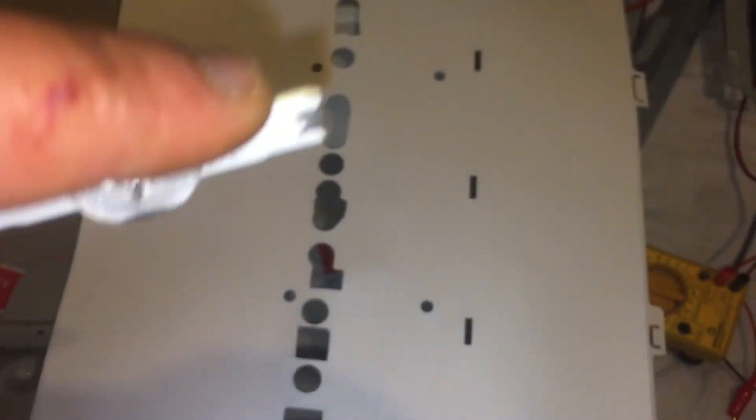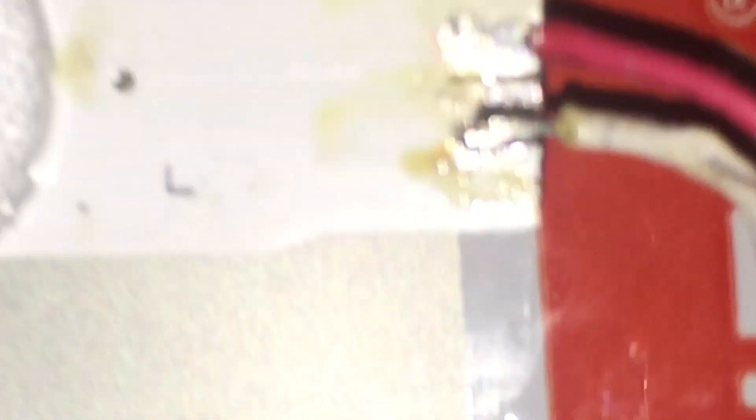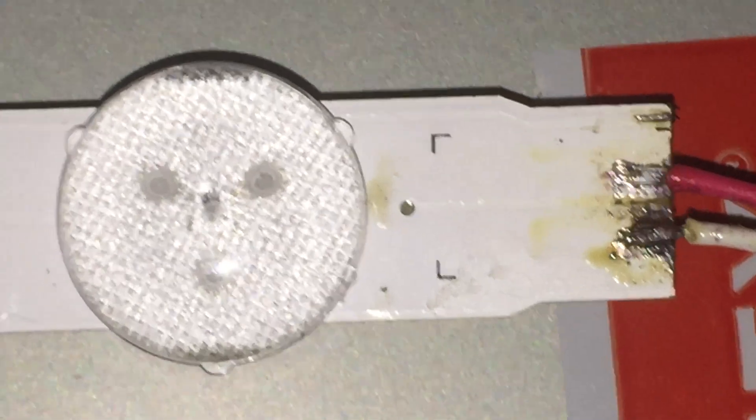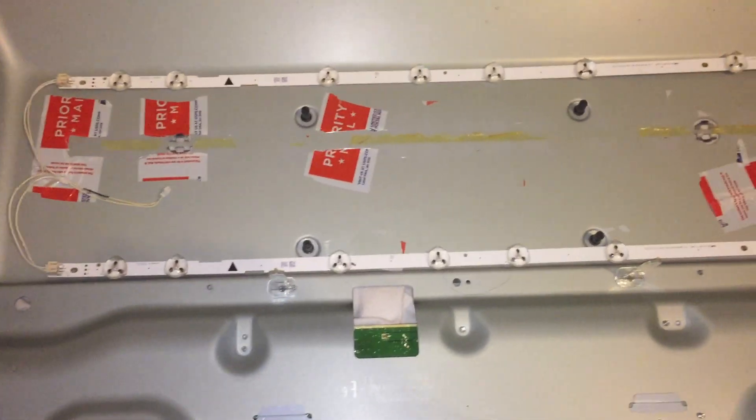I have the LED out - it's actually a Samsung, that's the model number right there. I put it under a microscope and have it broken apart - you can actually see the little white line right there. I'm still trying to look online for the positive and negative. I took off the bridge. These two ends were connecting, and on this side he used it as the negative lead to make it conductive. I re-soldered everything back together - you can see the gap in between, it's not touching now. I used a little bit of solder, being careful not to burn the LED connections. I'm gonna put tape on and check it out.